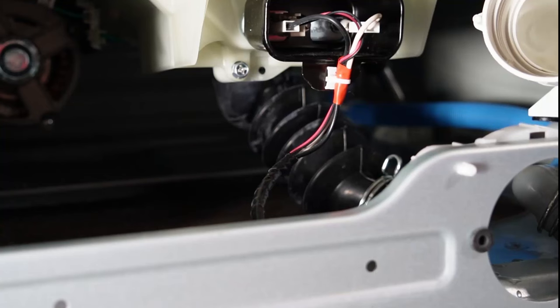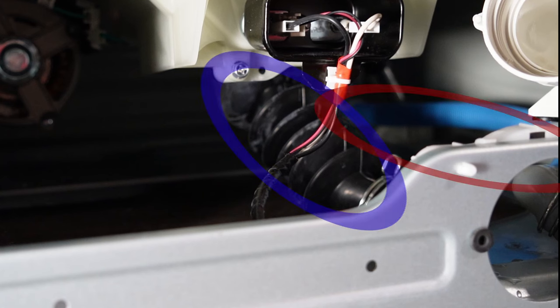While we're down here replacing the pump, another consideration is to inspect the rubber hoses that you pulled out and look for debris that could be lodged in the hoses, causing restriction or no flow to the hose system. You would need a flashlight and patience to look at the hoses to see if there's any sort of obstructions that would prevent the pump from working properly.